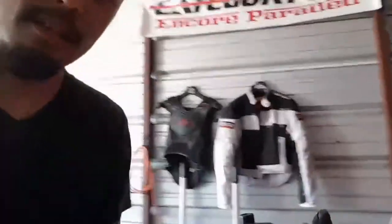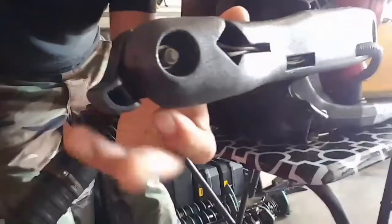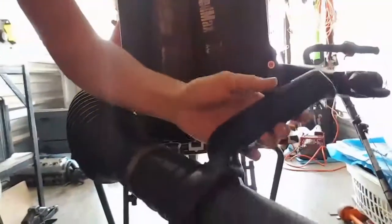I do want to say one thing — the first time I ordered this piston I made a mistake, so that's why it actually ended up taking a little bit longer for me to reorder another one. There was actually a difference in piston size depending on whether the trigger was on the left handle or if the trigger was on the blower handle itself. So this video should have been posted up a long time ago — I ended up ordering the wrong piston size because I didn't know the differences based on trigger location.